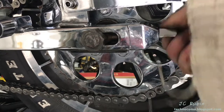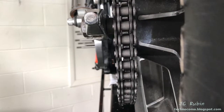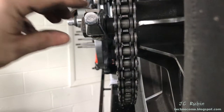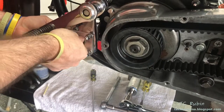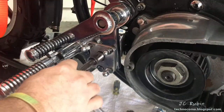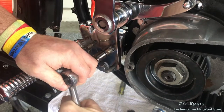I do the same thing on the other side, bringing both adjusters back progressively so the tire comes back straight. This is not final — just for testing. I'm using those two adjustments to set not only chain tension but also alignment, so when I spin the wheel you can see the teeth appear in the center of the chain, not leaning left or right. Soon I'm going to need the forward controls for shifting, so I polished them before putting them back on the bike.